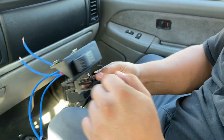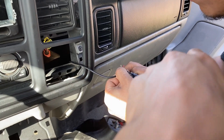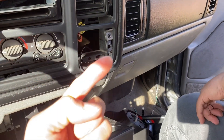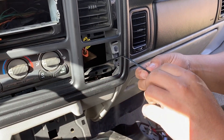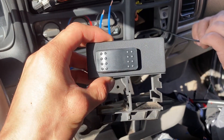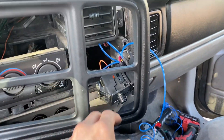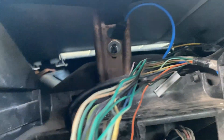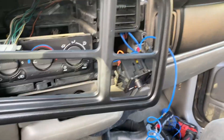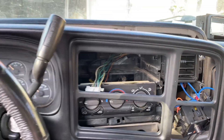There it is — got our switch. Now we just have to finish getting it wired up and installed. We routed that wire under right here to the dash area, under the glove box, through there. We got our functioning switch for the electric cutoff valve. For wiring, power's going to the radio fuse, ground right there, and then the other wires go to the valve — that's pretty much it.